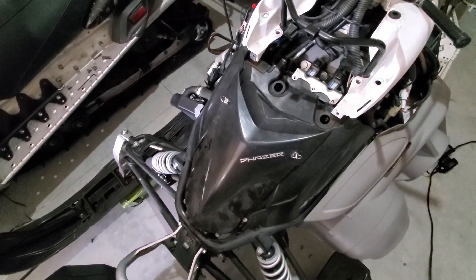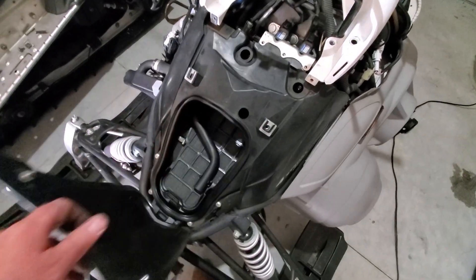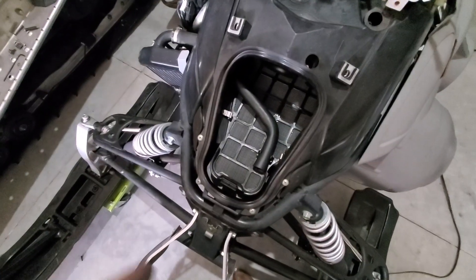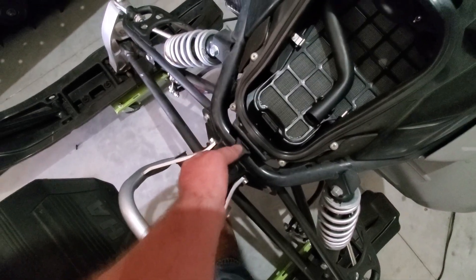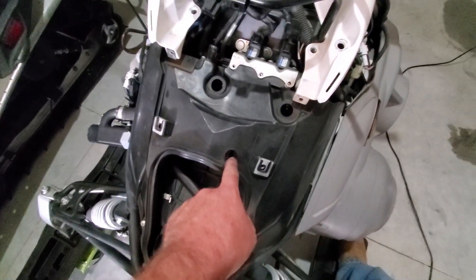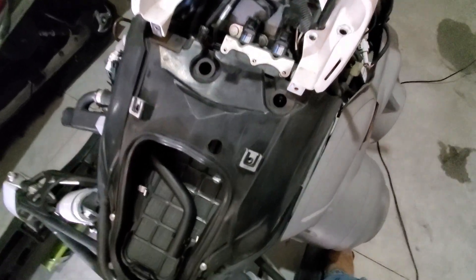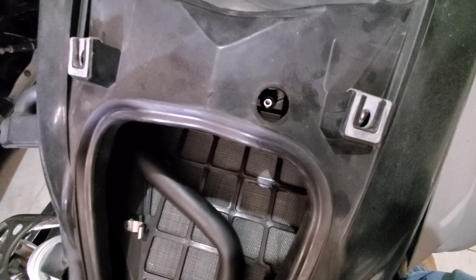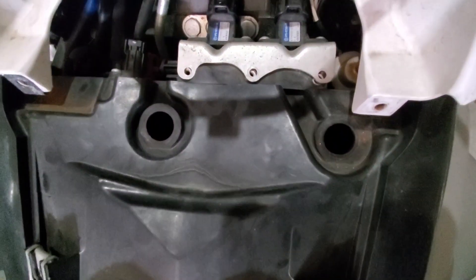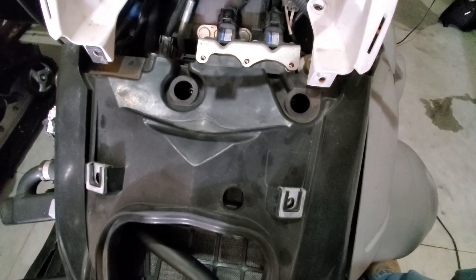Then the next thing you have is the air box cover. You have a keeper right here and a keeper right here — they both twist and the cover opens and then lifts right off the hinge at the bottom. Next, down at the very bottom you have a rubber strap. Pull that strap off and release it and it'll just lay right there. Then you'll find three rubber plugs — one here, one here, and one here — just black rubber plugs that pop in. Way down inside there are Allen screws; there are three of them, one there and one in each of those holes. They're way down in there, but the screws are captured so they won't fall off once you get them undone.